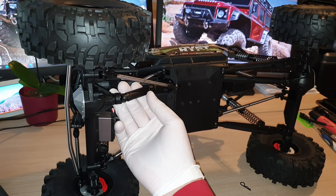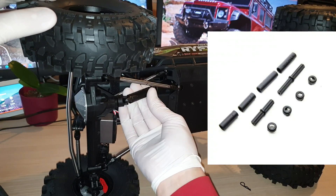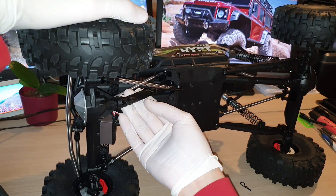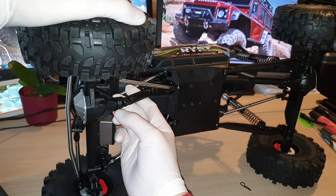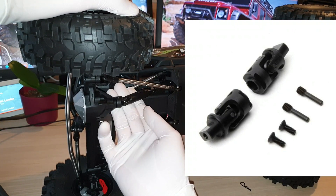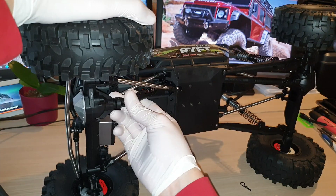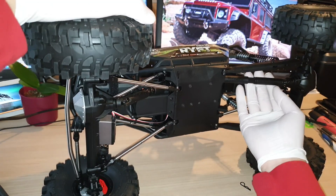The under chassis has a wild boar drive shaft — it is very robust, though the cover is plastic. I'm sure you'll be able to find aftermarket stainless steel or aluminum parts when they become available. Inside that adapter you will find a 6 mm output pinion, which is a little bit more beefy compared to the standard rock crawler — really good because it is quite a high-power rig and you need to oversize certain parts to take the power and not break down so easily. So it will last you quite a while before you'd need to change it out to metal parts.